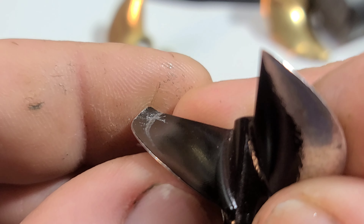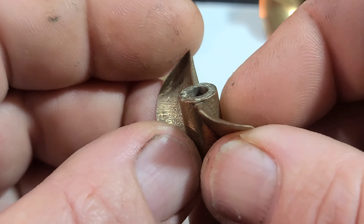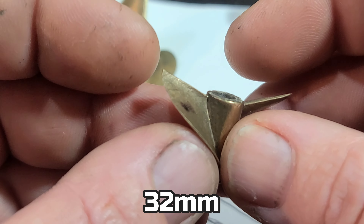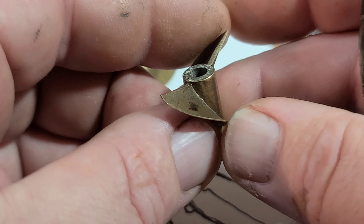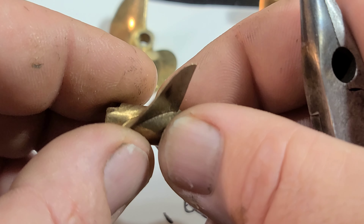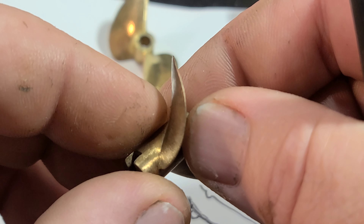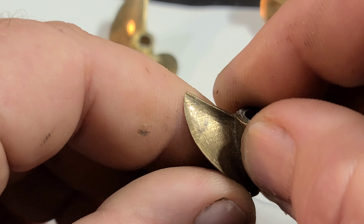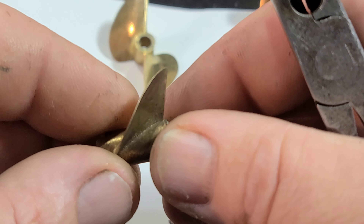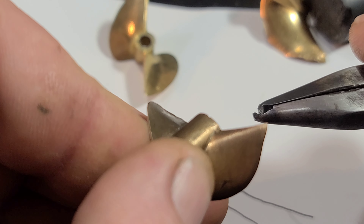This is a little ABC prop — it was actually a 15x16 that I cut down to about 30mm. I hit it on my rudder one day so the prop was ruined. You see how the tip, when the prop's spinning, you're going to lose all that water because I cut it down so much — there's nothing to hold the water in. I just did this one side. Look how perfect that is with these little pliers — it just scratched the anodize off. You see how it's cupped?